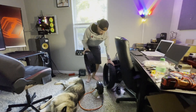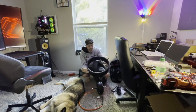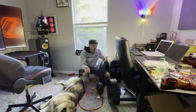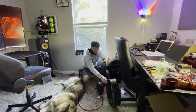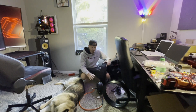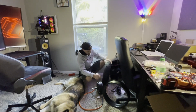We have the tires here — these are Shinko 567s, 120/70-16, a little bit wider. I have the double-wall rim and some 12-gauge spokes. I might actually attempt a cross spoke this time versus a radial spoke, mainly because I've enjoyed jumping the bike and cross spokes would be nicer. I'm not a very skilled wheel builder — the last QS205 was only the second thing I've ever spoked. With a 20-inch wheel the spokes normally go vertical, but some builders are bending them to allow a cross spoke pattern. I might give it a shot — it might work out, it might not.